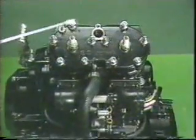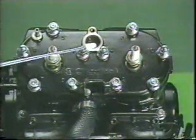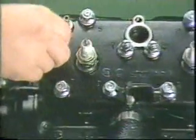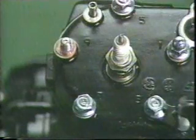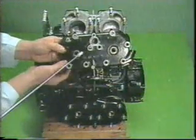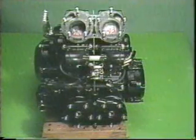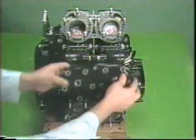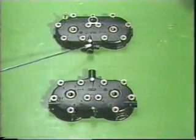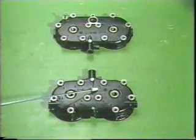The cylinder head nuts are removed from number 10 to number 1 in 2 stages. Crown nuts number 1, 4, 9, and 10 have copper washers. The thermostat outlet is located on the upper cylinder head. This is for the lower cylinder head. It is removed in the same way as the upper cylinder head. When installing the cylinder heads, the hose outlets face both the upper and lower cylinder heads.